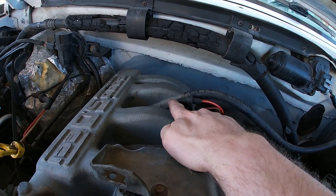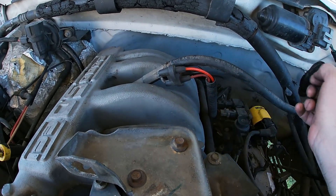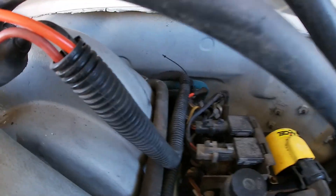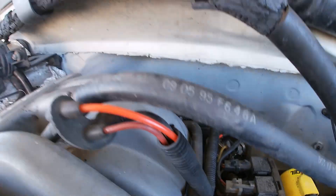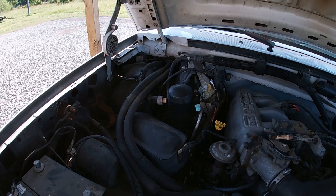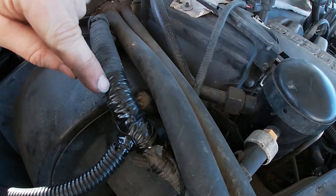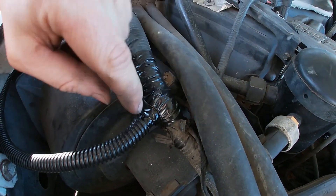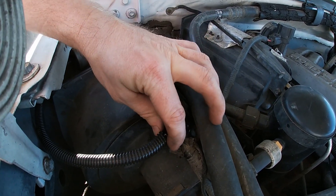Okay, truck side. I got that little piece bent back down where it belongs and the boot on there, so that's where I had to put the bevel — so it goes in there good. And it goes all the way down to the fuel pressure regulator. Using all the factory stuff, looks pretty good — looks like a good stock replacement piece there. The other one over here: I cut it back just a little bit, so that's why there's the new tape on there. Did a little zip tie underneath to kind of hold it — that was all one piece going around there. And I put a splice there, so I want to make sure that holds on good.